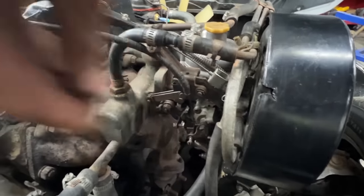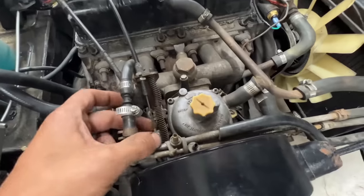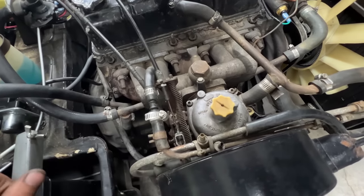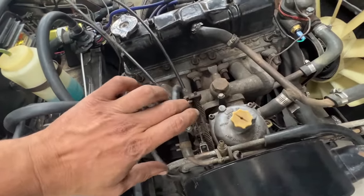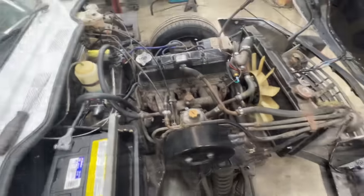The choke is off and can't go any further. I think the issue is the throttle cable — when you hit the pedal and let go, it needs to let go more. The cable is loosened as far as it can go here, and I'm assuming there's adjustment on the pedal side. But first I'm going to loosen the nut all the way so the cable comes off, and then we'll see how it idles.